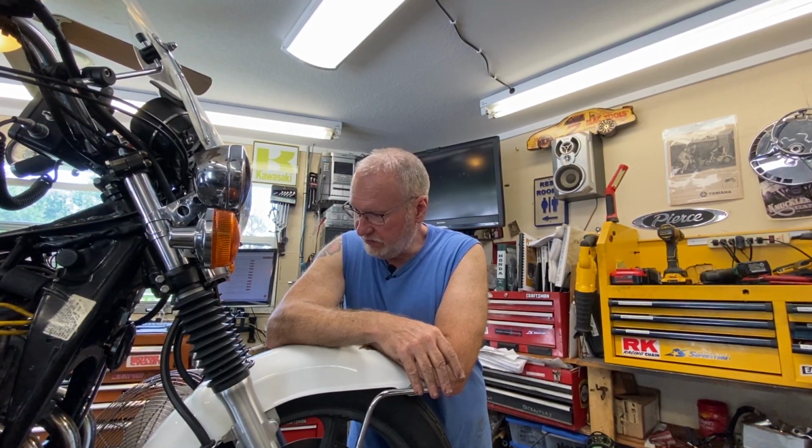But we've got this part licked actually, and I tell you what, I do not know what happened. I just don't. Too much going on, I don't know. But I thought in my head that 132.5 apparently was the proper jet size. That's why, when I read it on those carb jets that I showed you before, the ones that were in there originally, I thought they were the right jets. Obviously not. And if I had been able to recognize that, I would have been able to avoid all this hassle.